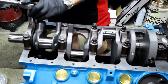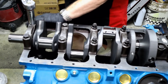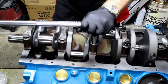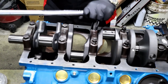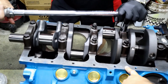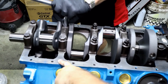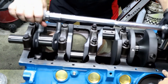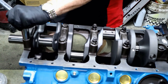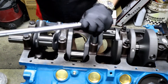Working through the pattern — ones on the end, number one, rears on the rear. Notice the pattern: now doing the 65, starting from the inside and working our way out. Start at number three, come over to number four, go back to number two, coming up to number five, and then back to number one. Now we're going to final torque — just giving this the quick test. Everything is spinning good so far. This is 85 foot-pounds.